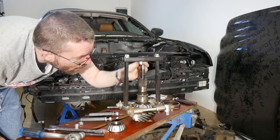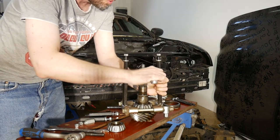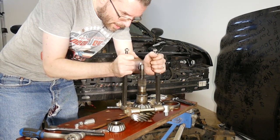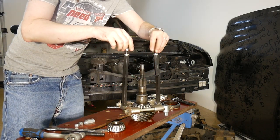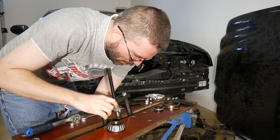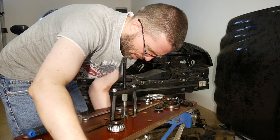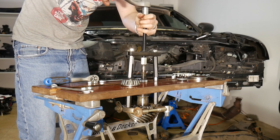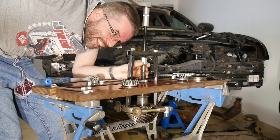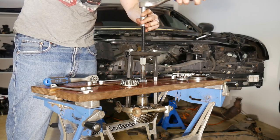But there's not enough space for my end piece to be installed, so let's replace the upper studs with two longer ones. Unfortunately, those were bent when I tried them on the pinion flange, so let's give it a try. This should help me to better counteract the ratchet. Must try to keep the end piece centered on the pinion shaft, but it doesn't want to.